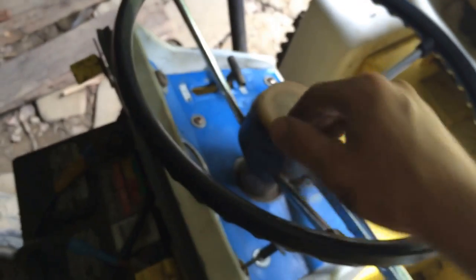If you follow my videos, you understand that earlier I had a problem with the steering. So I'm not pulling that off. I'll just mask over it and hope for the best. Probably sand the hood. I have some dents in it. You can't really tell because this is so dingy. The white paint's fading. I have scratches in the hood from the hood ornament scraping back and forth. Probably take the hood ornament off. Bondo all these little holes that are sticking out. Have bondoed this here where we welded the washer on when it broke.